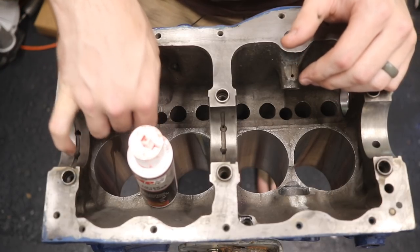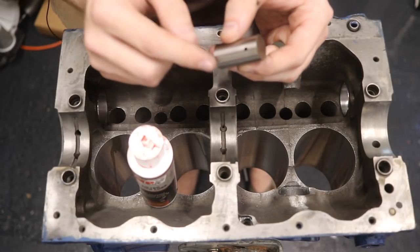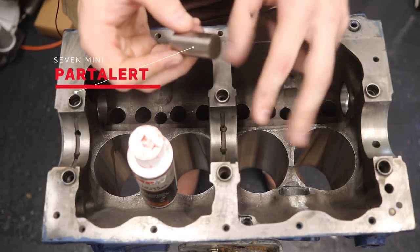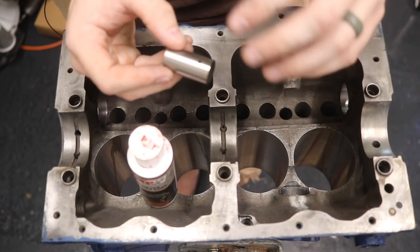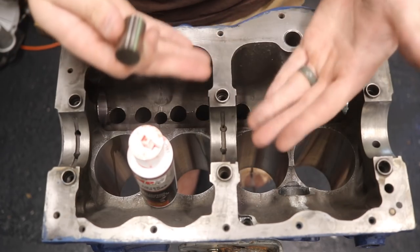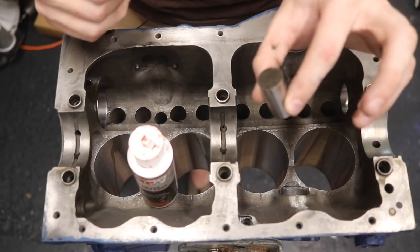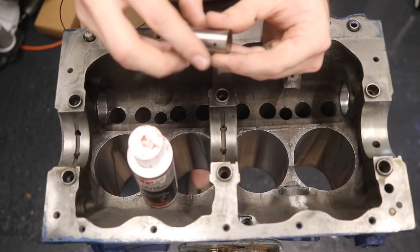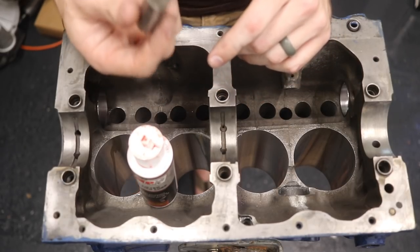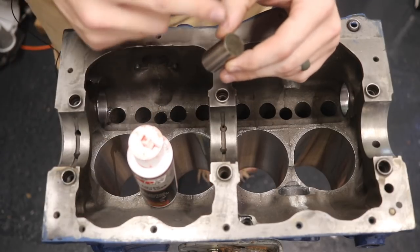These lifters need to slide in very smoothly into the holes with no resistance. These are cold-rolled steel or cold-rolled iron lifters — super reinforced. I got these from Seven Mini Parts. They have two kinds: the original Isky cold-rolled lifters and remanufactured ones that are just as strong but considerably less expensive. Either option is good. The benefit of these reinforced lifters is an actual hole for oil to pass around and through the lifter, keeping it cooler and more lubricated, and they're much stronger — a nice strong lifter for the brand new camshaft going in.